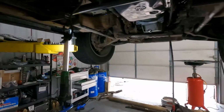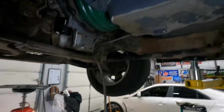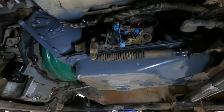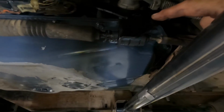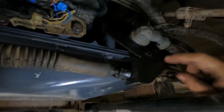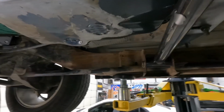Okay, 4L80 is in. The wiring is done. I've just kind of got everything set up here, but got the black box on the side of it again. Linkage is hooked up. Oh, you'll need this bracket also for 4L80, the shifter cable bracket. Your stock cable will work, but you need that bracket. That'll be another part number that's listed in the description here.